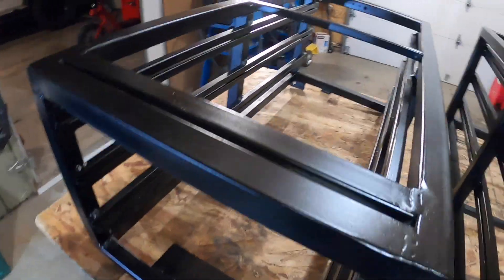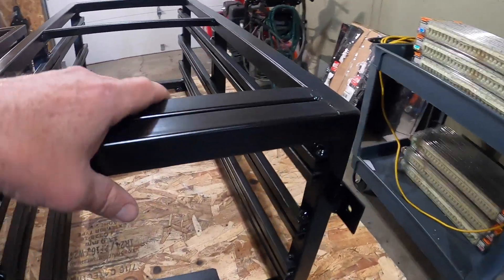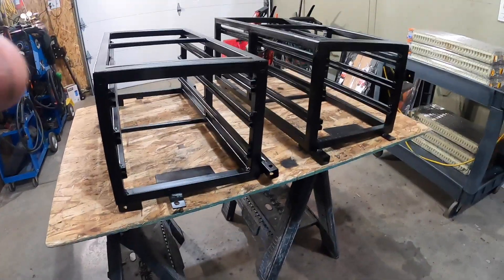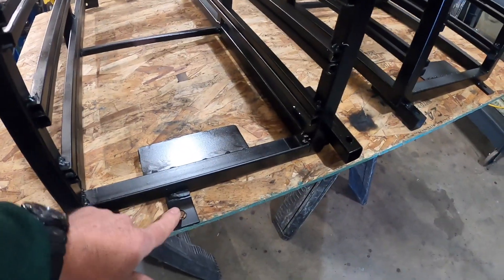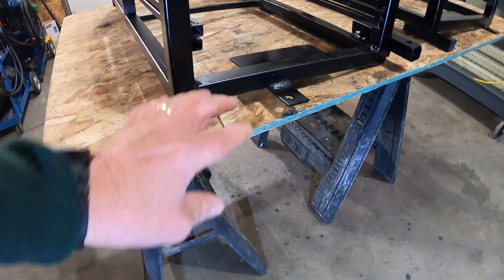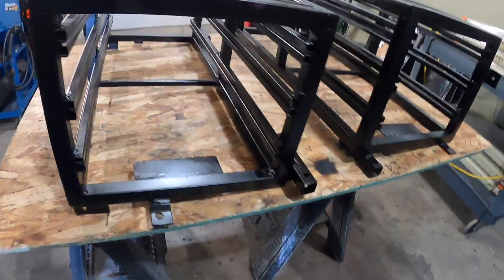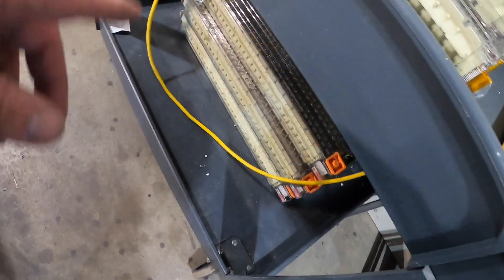There's going to be three batteries under the hood in the front — the frunk, whatever you want to call it on a Volkswagen Beetle. And then this is going to be the battery box that goes behind the rear seat in that space on the Super Beetle. I made everything so I'm not hacking the body. This total electric conversion of the Beetle is going to be reversible. This cage actually has the mounting bolts for the original gas tank, and I have a tab with an L-bracket that I fabricated that goes down onto the front mount of the gas tank. Everything can be taken out — I'm not hacking any steel. Three in the front, three of the Tesla S or X modules go in the rear.